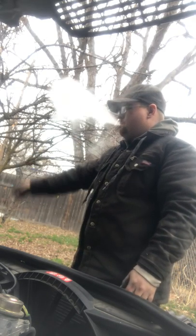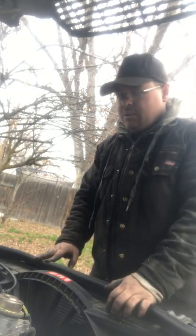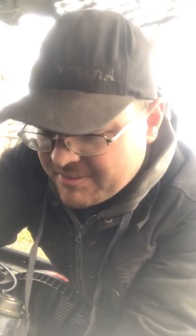And what shocked me was that this morning, I was thinking my air shocks in the rear would go low. They didn't go low, they stayed up. And what was even stranger is when I saw that the air shocks were low in the back yesterday, I went closer to it and parked it up on a ramp. Then all of a sudden, the rear end decided to rise up. Really weird. So that tells me the air shocks are sticking, which means they have to be replaced, which I don't want to do. But I'm going to. It's a fun project, and I'll show you guys how to do it too.